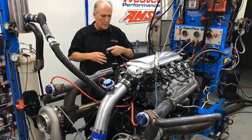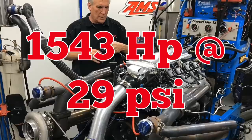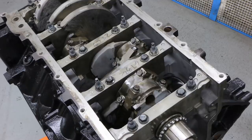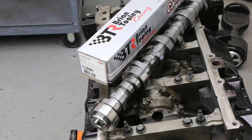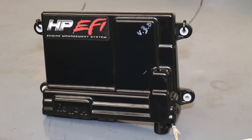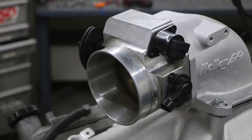Our test motor was the very famous LY6 Big Bang motor, the same one we made 1,543 horsepower with at 29 pounds of boost. The only thing that stock bottom end motor had was extra ring gap. For this test, we installed a centrifugal blower cam from Brian Tooley Racing. We also topped it with a set of Trickflow 225 heads, that Edelbrock SuperVictor EFI intake, large enough injectors, and a Holley HP management system to dial it all in. Topping the Edelbrock intake was an elbow from Holley designed to accept a 102mm throttle body.